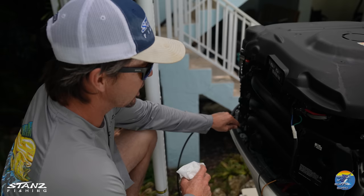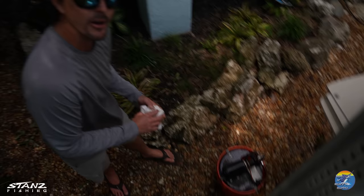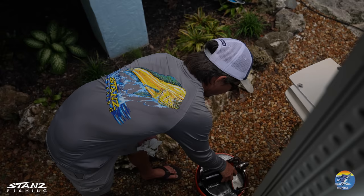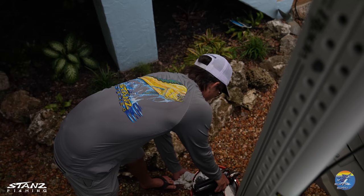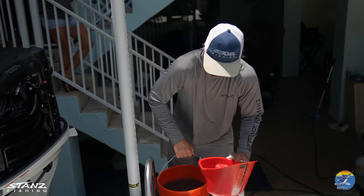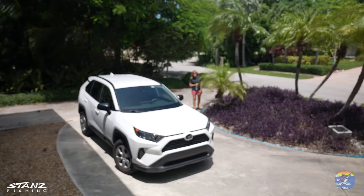You can hear the oil pump sucking a lot of air — it's pretty much done. Move it around a little to get the last bit out, then turn that off and start putting the oil in. There's about 110 hours on this oil and we're trying to change it right around 100 hours every time. We're just going to pour smooth and steady. Once we get about a gallon in, we'll let it sit, then go a little bit more and check the dipstick to see where we're at on the fill mark.